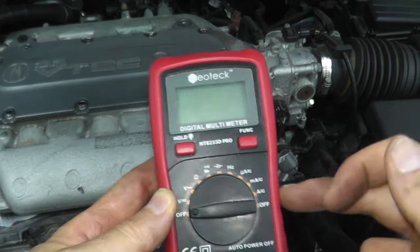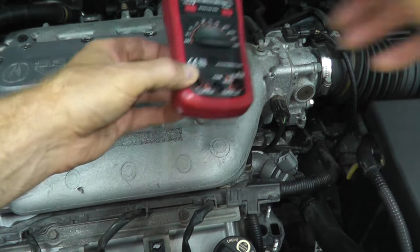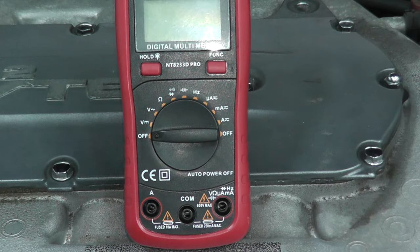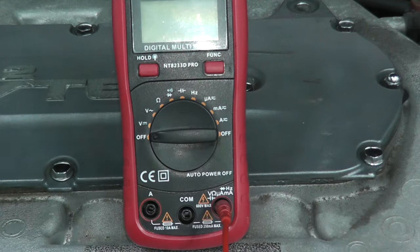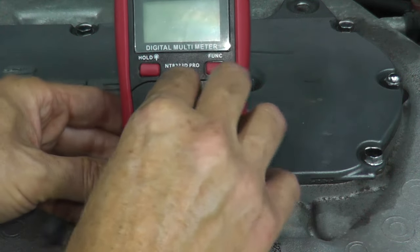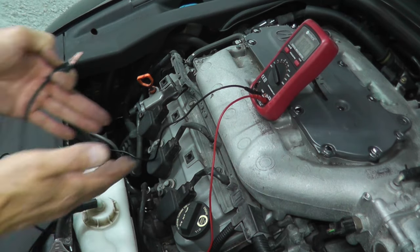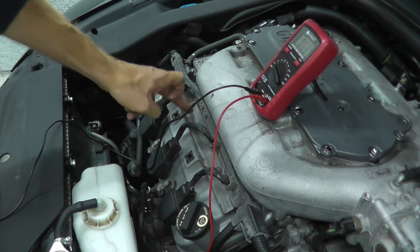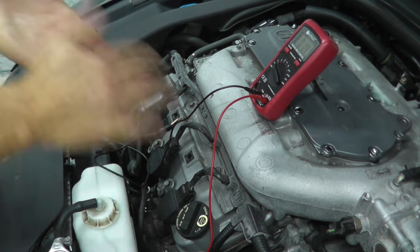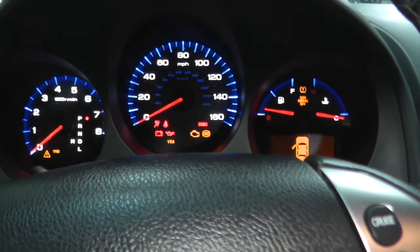What we'll need is a digital multimeter. If you don't have one, they are inexpensive — this one is $25, and I'll have a link to all of the tools in the description box below. When you purchase the meter, plug in the leads — you have a red lead and a black lead. We want to see where the power is, so we need volts. Make sure you're on the DC setting. The black lead is engine ground — that is any good metal point on the body. Right here is a metal bracket, so just clamp this lead to the metal bracket. Inside the vehicle, just turn the ignition on — do not start the car, just turn on the ignition.